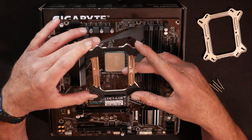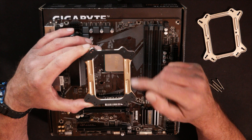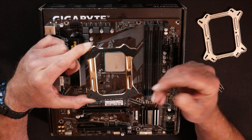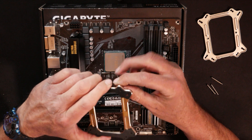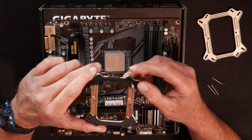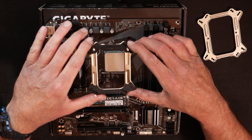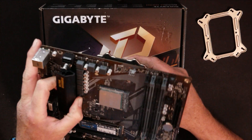The instruction manuals don't show this very well. This is the back plate that goes on the back of the motherboard — you can tell because it doesn't have holes for screws right here, and it doesn't specify which screw holes to use. The manual does tell you which ones line up with your motherboard layout. For the AM4 socket, we need to use these holes right here on both sides, in all four corners — these are the ones that line up with the AM4 socket. We're going to get all four of these shoved up through here.